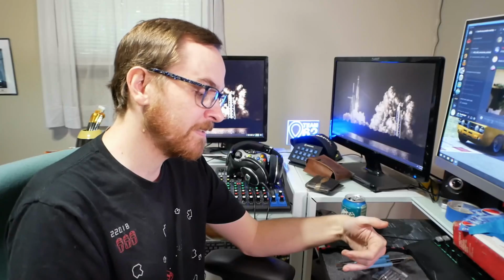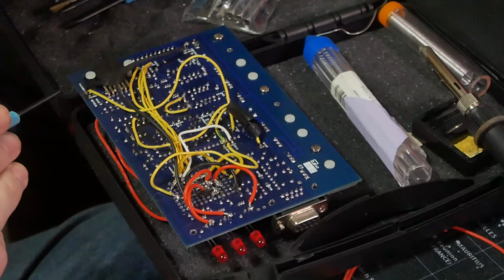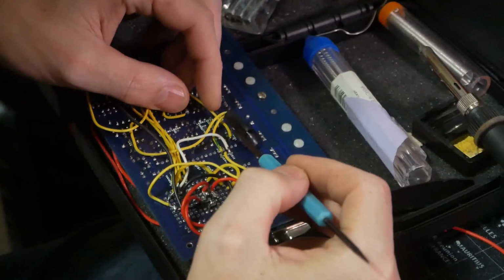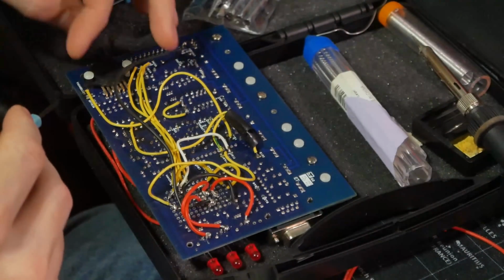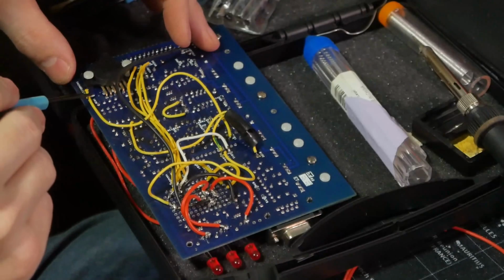So I need to do some work here on the board in order to hook up the inputs from the VR sensor into some of the inputs on the ECU, so that the tune can be set up to have VR input. I'm doing this inside today because it's freaking hot out there. So, garage office. All right, so currently we have tach select going over to XG1. Tach select needs to be going to VR in. So that's just a short jump there.